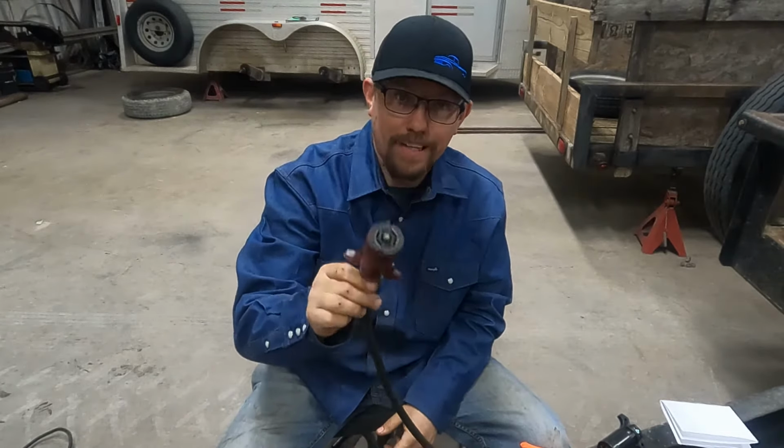So now we're going to take our hot. I have somebody standing at the back of the trailer. We're going to see which wire goes to which. In six-way wiring, like I said again, just remember, this is six-way wiring code that we're putting in a seven-way RV plug. So normally your yellow is left turn, so I'm going to turn that on. So we're left turn there. Your red wire is normally your hot 12 volt wire that will charge your breakaway battery system, or if you're in a cargo trailer, this would maybe turn on any auxiliary lights you might have.